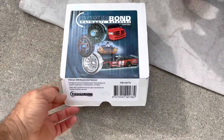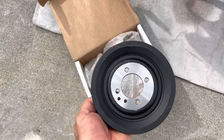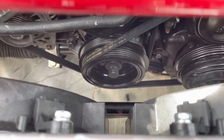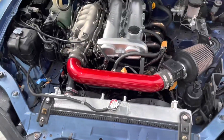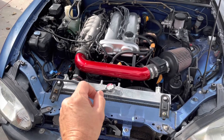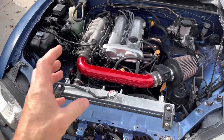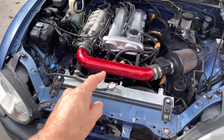Welcome back everybody. Today I'm going to be swapping out this Dayco harmonic balancer, also known as a crank pulley, with the stock crank pulley. I've got a little bit of a pulley wobble — even though I've already replaced the front end, replaced the bolt, and added the crank saver attachment, which I have in another video. Still have a little bit of wobble, let me show you.